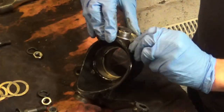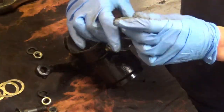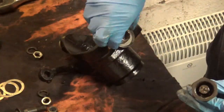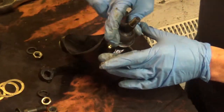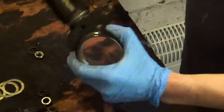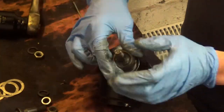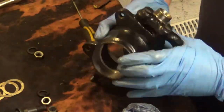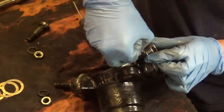For this section I just decided to speed it up because putting the shims in is just trial and error. The shims come in all different thicknesses, so the idea is just to put a couple of shims in and feel the play. If there's too much slack in the ball joint, take a shim out and try it again. They're all different thicknesses so you really just need to play about with it until you get the feeling in the ball joint that feels right. According to the Haynes manual, you want a little bit of drag in all directions — up, down, left, right. You want to feel a little bit of resistance and you don't want the pin to be sloppy. So that's basically what I'm doing here.